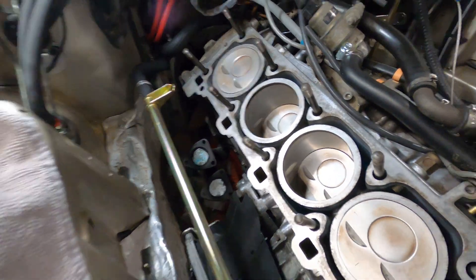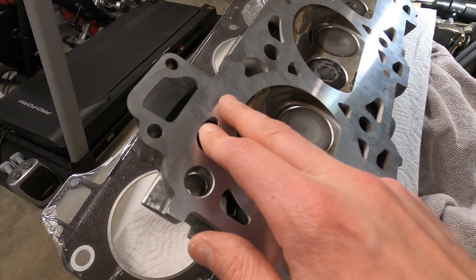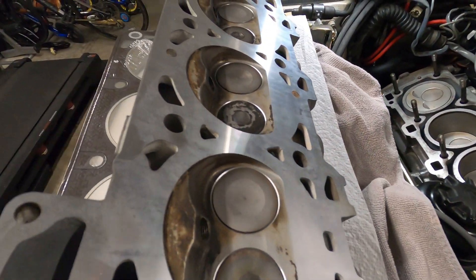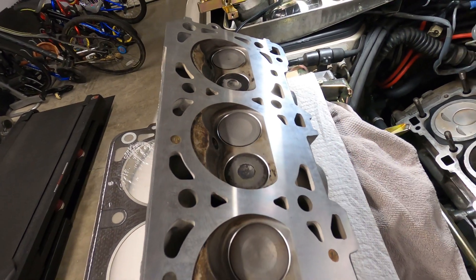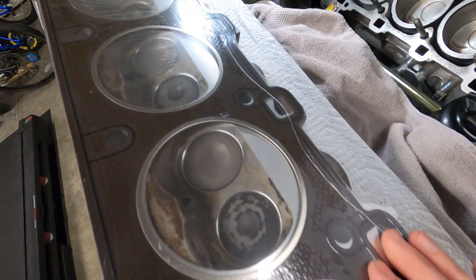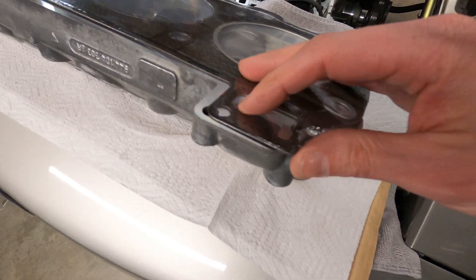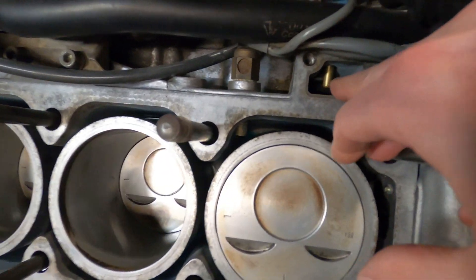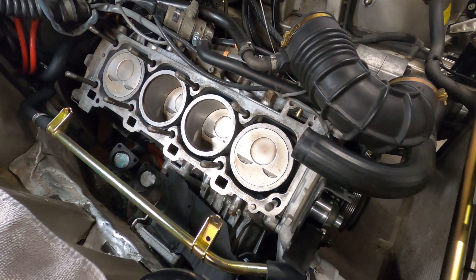At the back of the system, it takes an upward turn into the cylinder head. Here on the underside of the cylinder head, we can see all these channels and cavities where fluid can pass through. The four along the bottom are the oil passages that supply oil to the camshaft housing. The circular ones are just pass-throughs for the mounting studs, but all the others are coolant passages so that the valves and the combustion area can be cooled as well. When the head gasket is applied, it blocks most of those off to allow for directional flow, so only the ones at the rear are open. Fluid moves through here and exits the water channel, which dumps out back into the block by the temperature sensors underneath the water pump, and the system is essentially making a vertical circle to cool things that way.